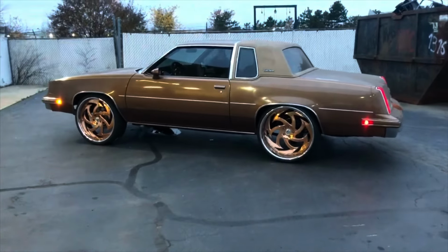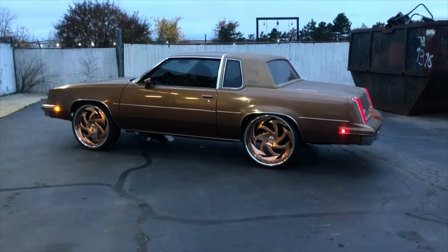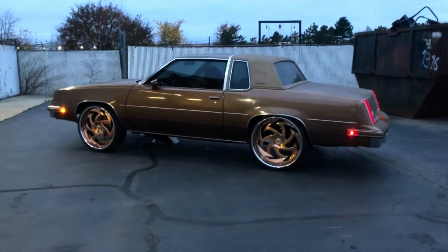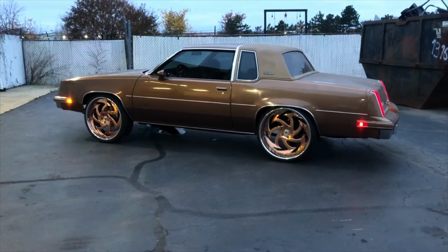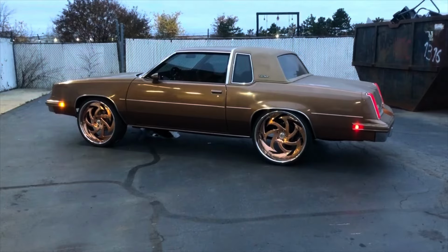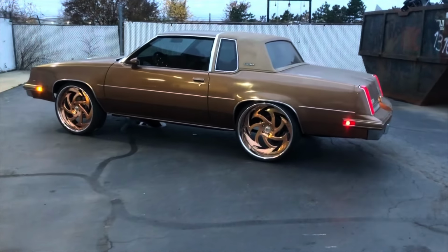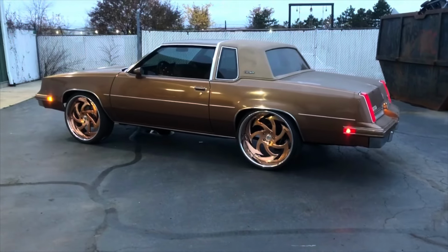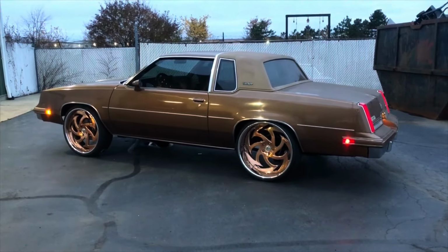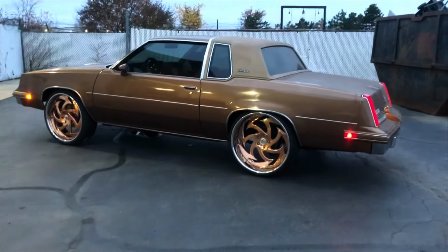And what I was saying is, right now there's wheel spacers on the back, 1.5 inch of wheel spacing. This wheel comes out to about a 5-inch lip. So once the wheel is changed to the smaller back barrel and the bigger front barrel, we'll be able to take off the wheel spacing, because I have the 3-inch studs, 1/2 inch by 20, Strange. That's what those are. The cheapest for the best price, best bang for your buck on those, which are still good.